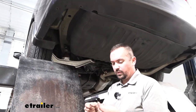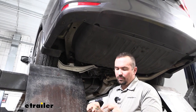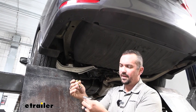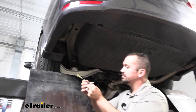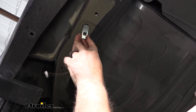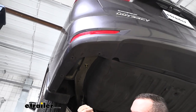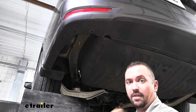We're going to use a reverse fish wire technique. Grab the fish wire, a carriage bolt, and a spacer block. Take your coiled end, slide the spacer block on, and thread on your carriage bolt. There's an access hole in the frame that allows you to slide the carriage bolt and spacer block up — as we pull this down it creates a mounting point for our hitch. Leave the fish wire on, and you can put a slight bend on it to help feed this onto the hitch and keep it in place. Repeat the same process on the other access hole.